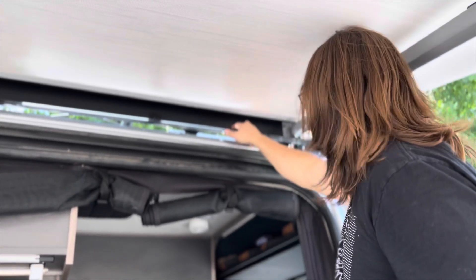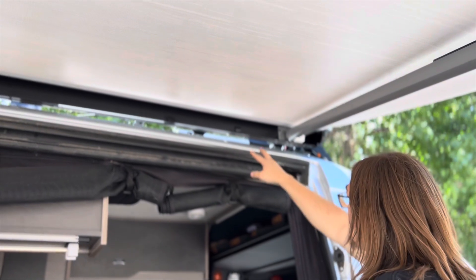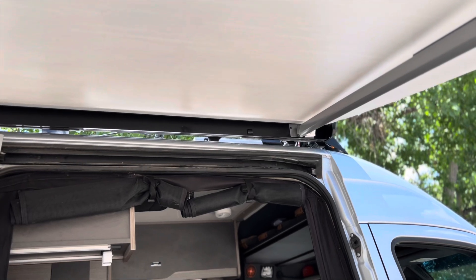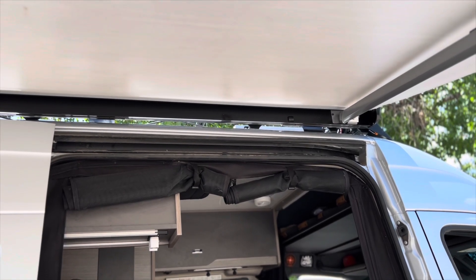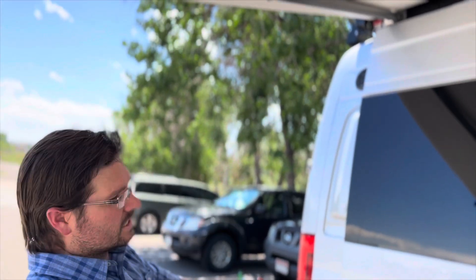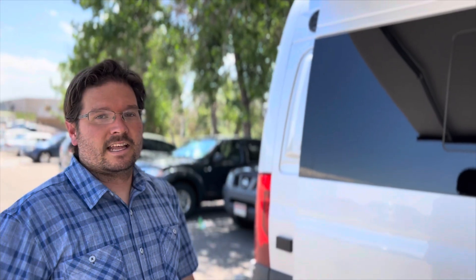You could just slide this around and it's going to stay there — though your long-term road miles are going to make it vibrate around a little bit. These bumpers help you get the first two inches of the awning open. If somebody's having problems where the only way they can get their awning to extend is by giving it a firm slap, most likely those bumpers either were set or drifted towards the center. Some people understood them to be 12 inches from the elbow — way over — instead of 12 inches from the case connector. What those are actually doing is, as the arm comes in, they're causing that aluminum to flex. So when you hit extend, that aluminum acts as a spring, springing the awning open those two inches. From there the springs inside the arms can take it and extend it the rest of the way.